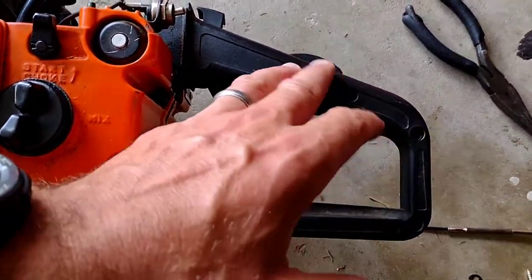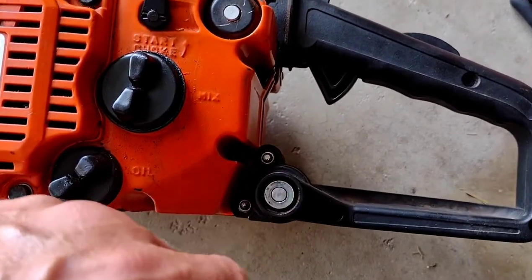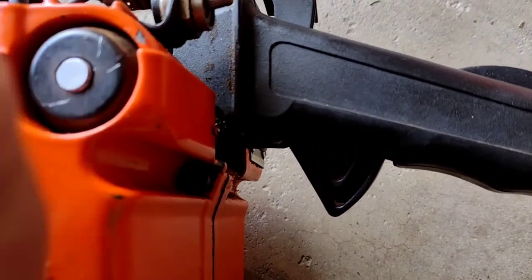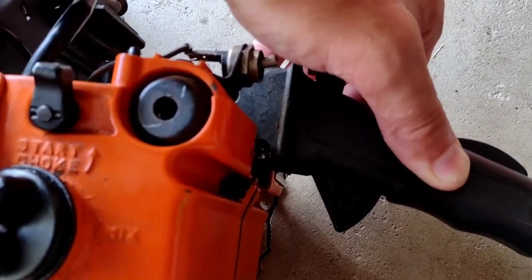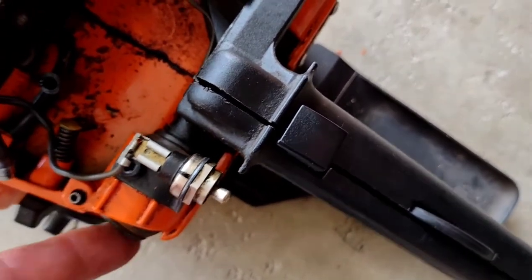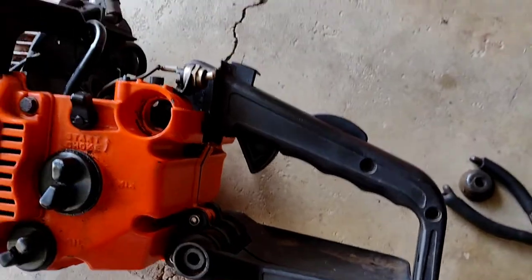Quick update: I got five screws out — one, two, three, four, and one that sits down here makes five. I took the two E-clips out. When you take those out, be very careful because they can go flying. My next step is to push these two pins through, then tilt the handle back — there's a sixth screw right there, really tight, you've got to get a Phillips head in there. The rubber grommets are in so tight that's a real pain getting them out, and especially putting them back in. Once the grommet's out I can pull the left side of the handle out.